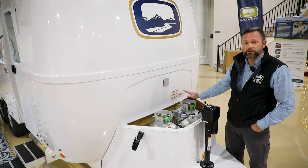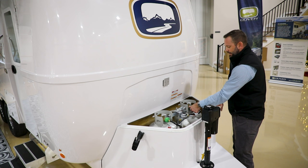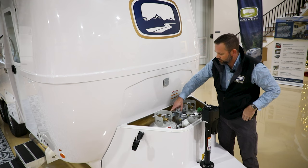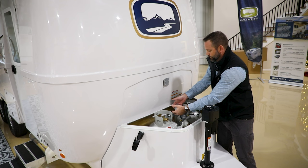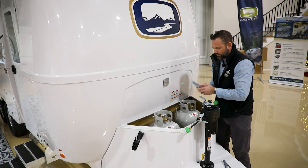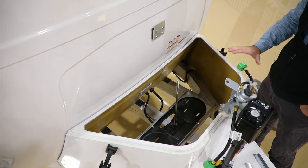Now we're going to look at how to remove the tanks. When they go empty and need refilling, you'll have to remove them from the camper. First, make sure both tanks are turned off. Then simply disconnect the regulator pigtails from the tanks. There's a wing nut on top securing it — turn it left to loosen. Lift the regulator assembly up and off, move the hold-down bar, then grab the tanks and lift them straight up and out of the camper.